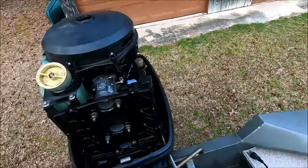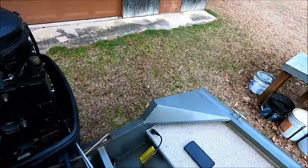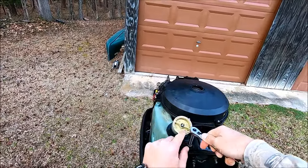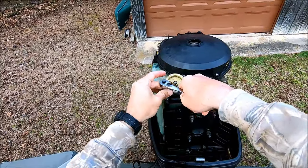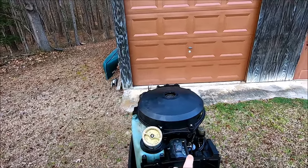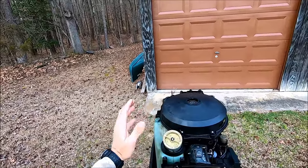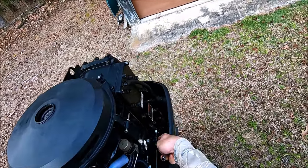This is where you use your 13mm deep socket right here. We need to take this apart — this holds your oil tank in place, so these are 8mm bolts. A short 8mm works but a long one makes it a little easier to clear. Take this off and put it aside. What's holding your carbs in place right now is also holding this in place, so once you loosen it you'll pull your oil tank forward and want to push it back out of the way — use tie wraps or cable ties to hold it. But before you take this off, you have to disconnect your steering cable and throttle linkage right back here.